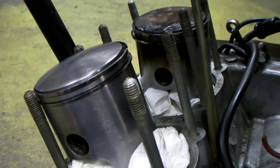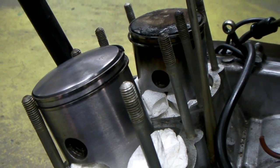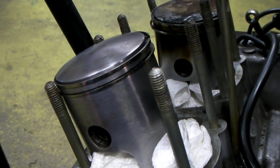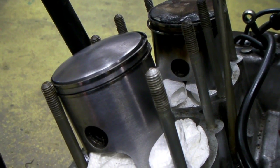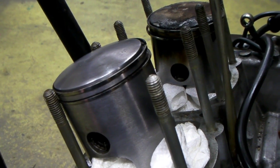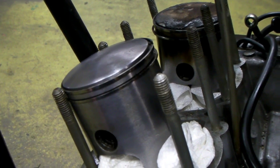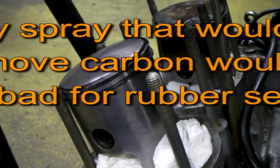The piston gets rid of its heat through the rings, and if the rings are stuck, the piston's going to overheat. You get blow-by — it's just a condition that's going to snowball on you. So about every 8,000 to 10,000 miles, you better do it on one of these two-stroke bikes. Some of the synthetic oils, you might get a little bit more than that out of it — some of those tend to carbon less — but you're going to get carbon just from the gasoline, and nothing you spray in your carburetor is going to take that carbon out of that engine.